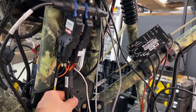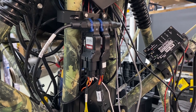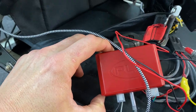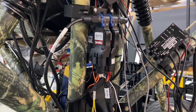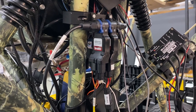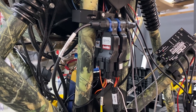The other module has four analog channels and a frequency channel. The four analogs give me incoming air temp into the engine, oil temperature, oil pressure, and the air-fuel ratio signal from the PLX unit. The PLX unit shows live AFR and uses an O2 sensor. The reason for bringing the PLX AFR into the Banks system is that the Banks system does data logging, so having that mixture information should give more accurate engine calculations.